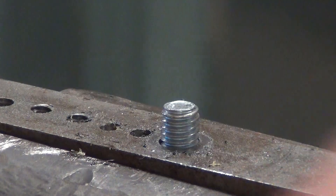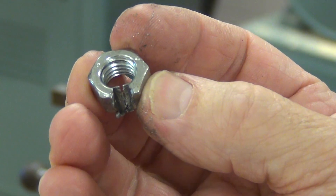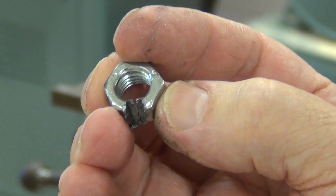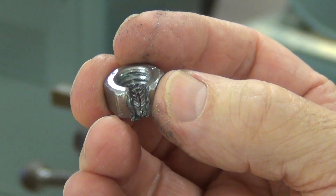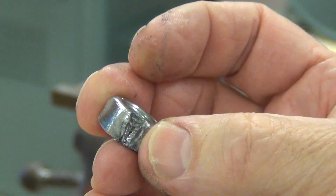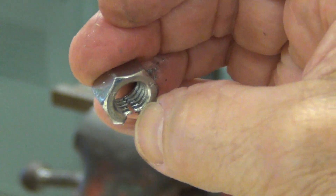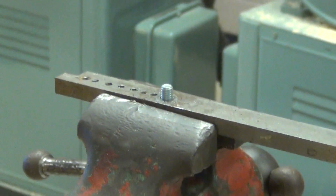Let's see how that looks on the camera. Get a good sight — back up just a little bit. Look at that — I believe that actually fractured the nut. And if that was a frozen nut on there, if it was really tight, I could probably whack it a couple more times and get a little more space there, and then it would definitely come loose. But the cold chisel really did the job on that one.